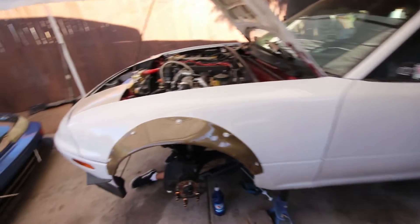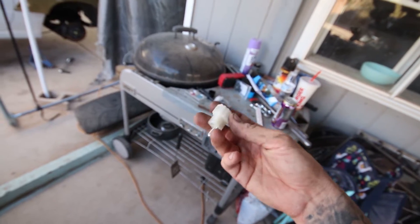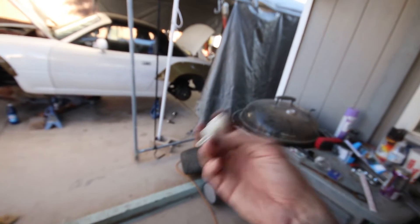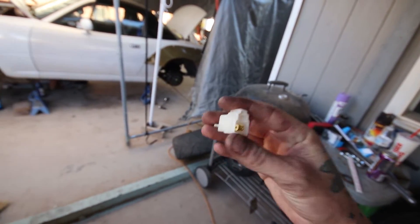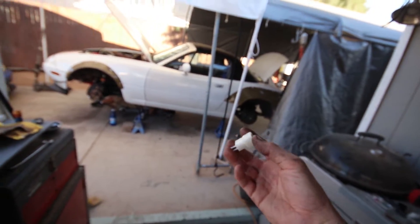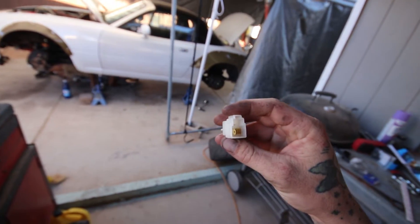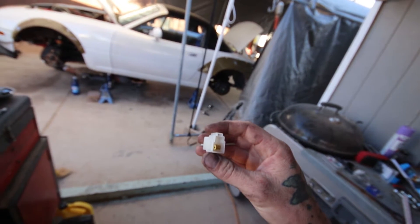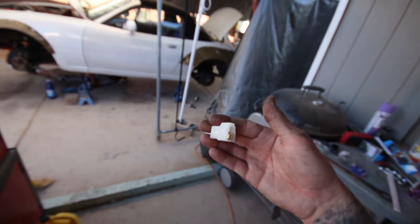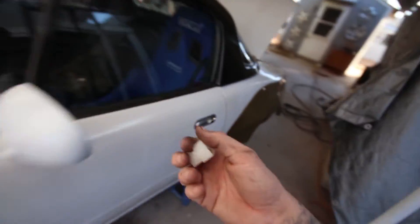This is another thing I bought from Super Miata — a clutch switch bypass. You could make one yourself but it was like six bucks. This way you don't have to press the clutch in to start the car. A lot of companies say that with aftermarket clutches on Miatas, pressing the clutch in puts extra wear on the thrust bearing. I bought it to be safe — I don't like using the clutch to start the car anyway, I never leave it in gear. I just have to crawl into the dash and figure out exactly where the plug is.